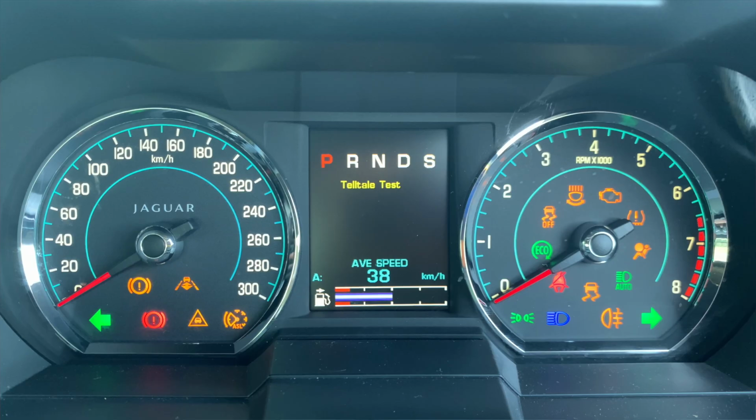And sometimes these ghost faults go away by themselves, and sometimes they stick around as real issues. Think of them as electrical gremlins, and many problems can be traced back to a poor performing battery. But also don't ignore red lights that appear in the speedo dial. Just because you think it's a battery issue, maybe it's not. And if there's no record of a battery change within the last few years, budget to replace the battery as soon as you take delivery of the car.